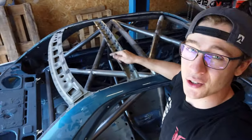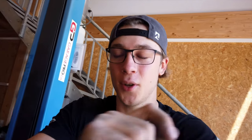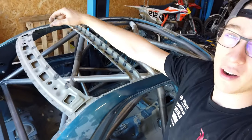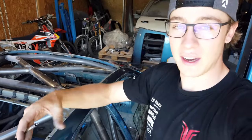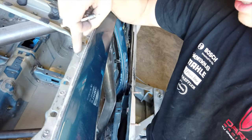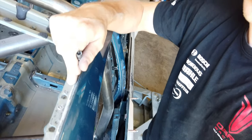Starting off with the roof support, the first thing to do is remove that factory support that I don't need anymore. The thing I'm using here is my trusty little spot weld drill bit — I got it off eBay and it holds up perfectly fine. You've seen it work in the roof removal video. I'm going to use it again on this support. Once that's done, I can clean up the entire contact area from the roof skin. From removing the roof, we have a bunch of imperfections due to the spot welds that were there.